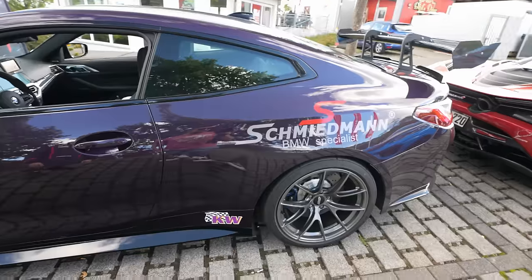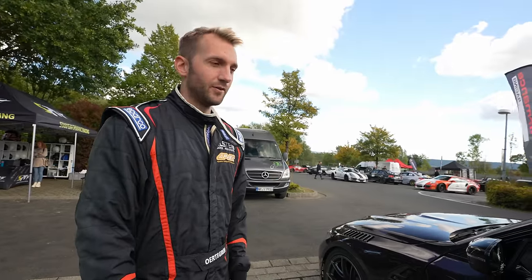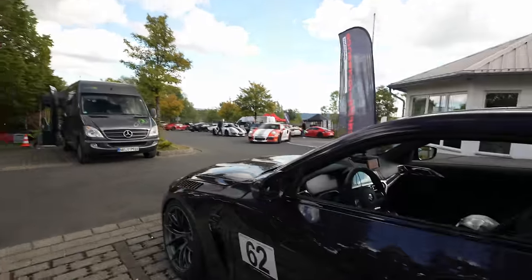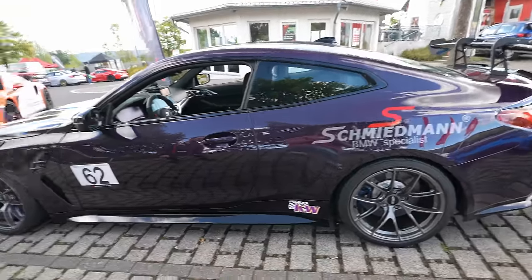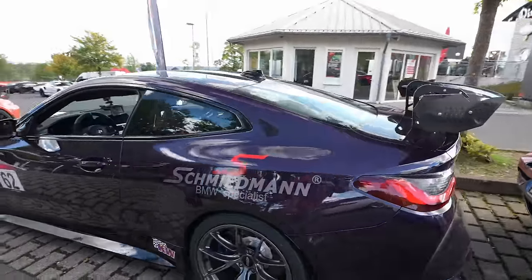Yeah, so it's actually quite a lot of testing. We went with a KW sleeve kit, with the shock absorber first. Just made a few track days, but it was way too soft. Yeah. We got a good deal from KW. It's been very good. So as mentioned, we already did a lap and it was quite impressive. I was very happy to see that the car was very stable.